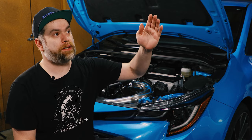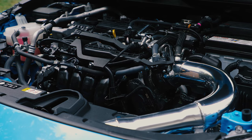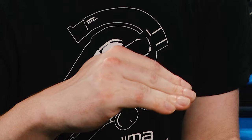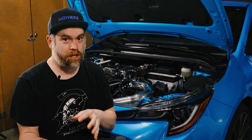There was a short period of time after I cleared all of the codes that the engine, when I was driving, was fine. No issues with revving or anything like that. When I would come to a stop and the engine was idling, there was a little bit of fluctuation in the idle, and it would hit around 500 or just under 500 RPMs, which caused the engine to shake. But after a couple of days of that, which again, this could have been tied to my mistake with the MAF and the check engine light and all that, the engine management system adapted for the new air fuel ratio. Toyota engine management systems, they figure that out on their own. You can't flash them or tune them or anything like that. They just, oh, there's more air, let's do a little more fuel, up until you hit your limits.